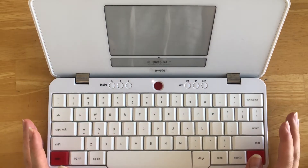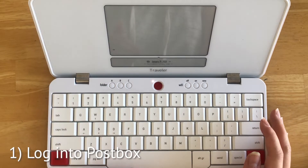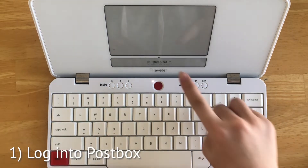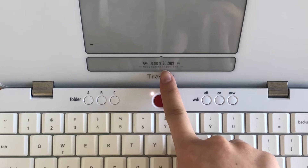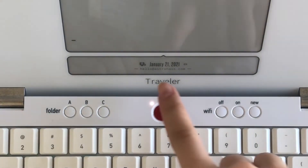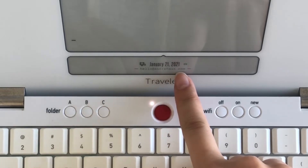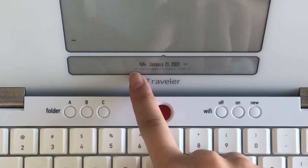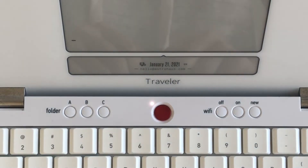To update your firmware, the first thing to do is to ensure that you're logged on to your Postbox account and connected to Wi-Fi. You can verify this by looking at the bottom status screen here. If you're properly connected to Postbox, your email address should appear right at the bottom here with a solid line on each side. If the lines are broken, you're not connected to Wi-Fi.